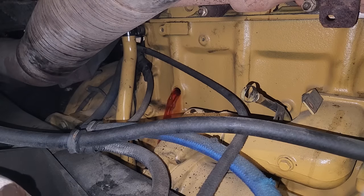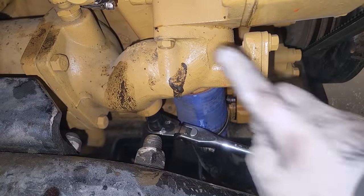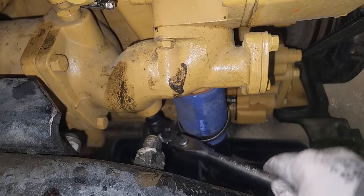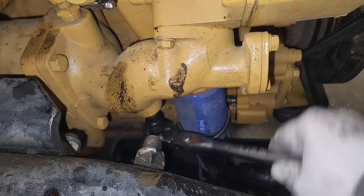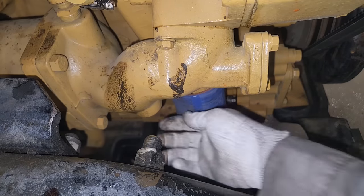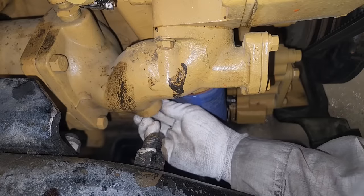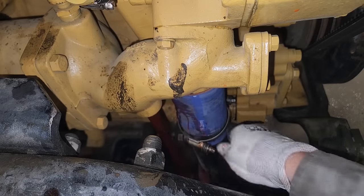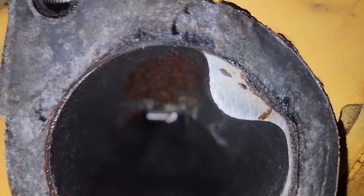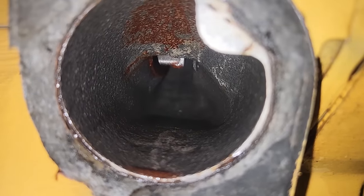It seems like it's full in the block, so since the block had coolant in it, that's a good indication this engine's probably not completely destroyed. This tube here is your water pump outlet tube — it pulls coolant mostly from the lower radiator hose and pumps it through the oil cooler. I'm draining it to make sure we have coolant in the oil cooler, which would indicate coolant is throughout most of the system. There is — good, clean coolant, not plugged. Oil cooler's in good condition. But at the water pump — rust? That's really weird. It's not normal to see rust. Hopefully nothing is destroyed.